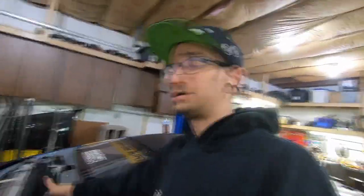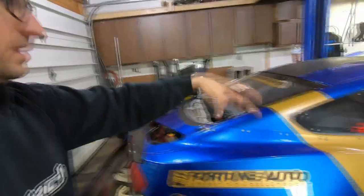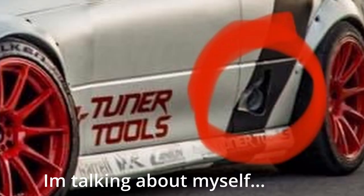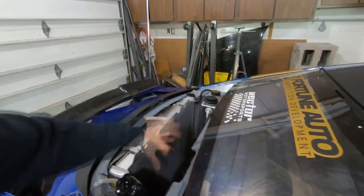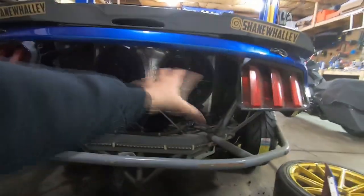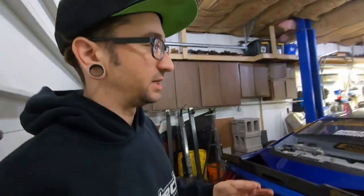I do have a video on when I did the triple-pass conversion on this radiator so I will link that in the description. Now like I was saying, a lot of people focus on building crazy ducting — NACA ducts, air scoops, all kinds of stuff to get airflow into the radiator core — but I found that's not nearly as important as having good fans. As long as you have an open area to create pressure differentials that can suck air in through here you're going to be fine. Just don't enclose this off; make sure you have good room in front of and behind the radiator.